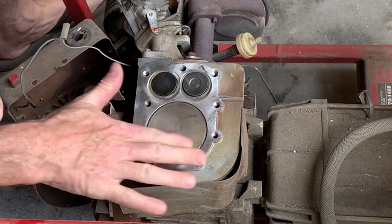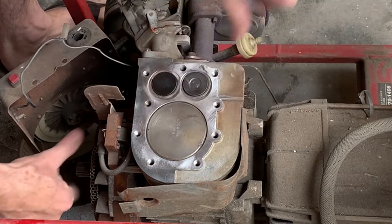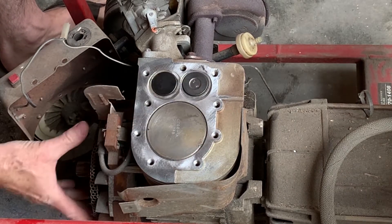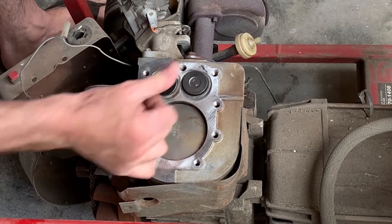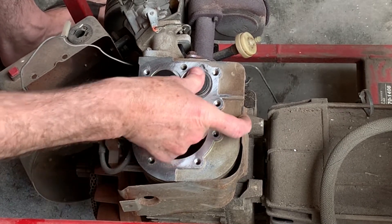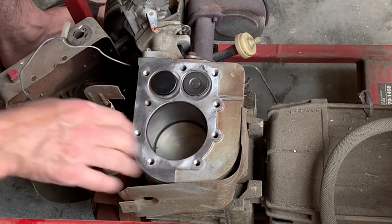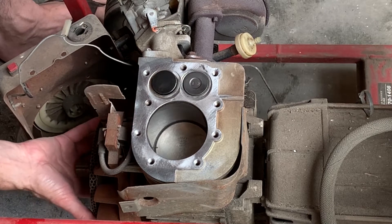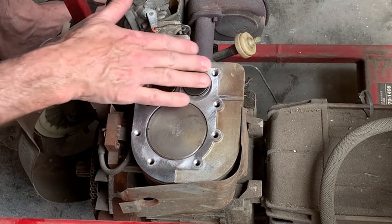This is my personal generator and I know it was running well when it quit running. When I put this piston on top dead center there's a little bit of play in the valves, but I think they're good because it was running good when I put it up. When I seat this valve right here it's pretty tight. If I seat this other valve it's a little bit loose, but I think it's fine. I don't think I need to lap the valves — this generator doesn't have much run time even though it's 23 years old, and it was running good when I put it up. So I think what I had was a head gasket leak.